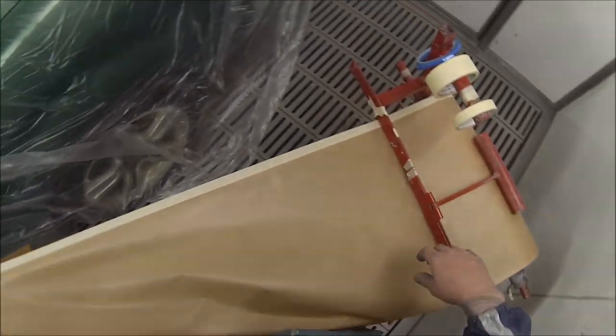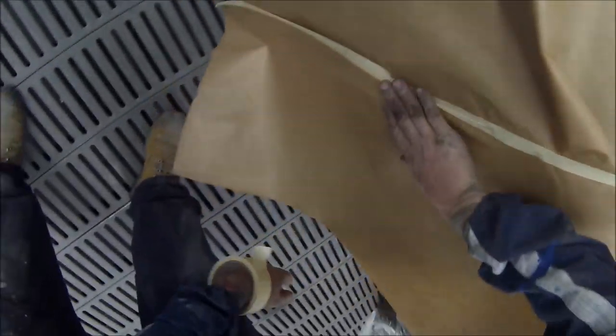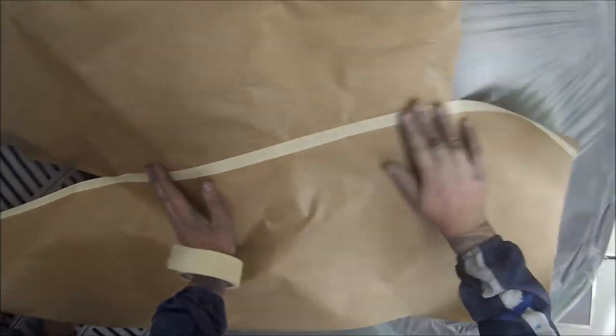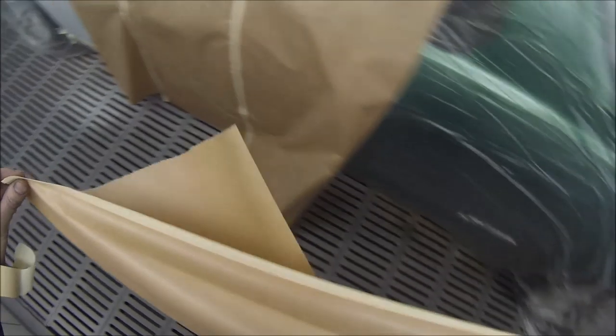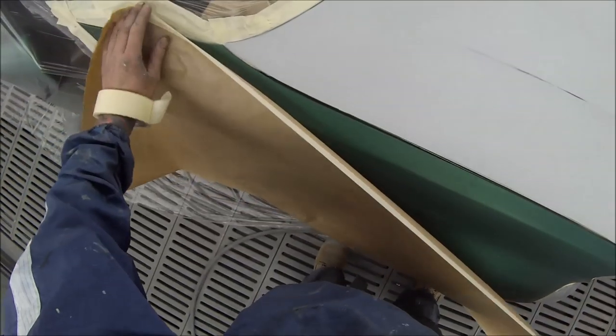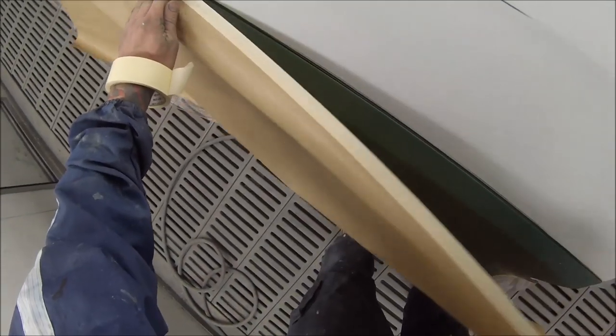What I'm doing here is covering up the blend panels and using what we call a ground coat — just a bit of green to put down over the prime sections and the new panels so we've got basic coverage before we start putting our top coat colour on. Most greens really don't cover too well in solvent-based.